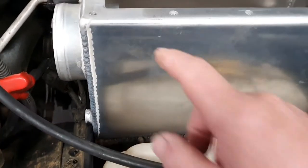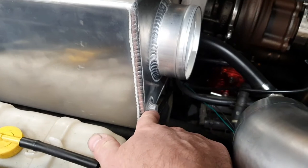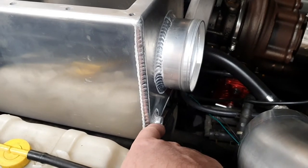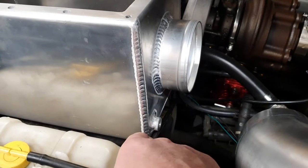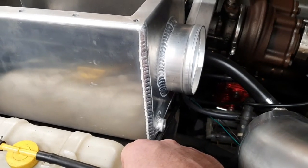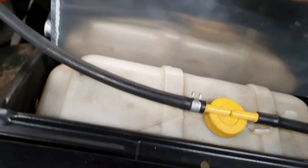There's a minor technical hitch with the air box fitting into the battery bracket area. Several ways to fix that: put a hole saw over the top of that, bore it out, push it flush, weld it back up — done, do that on all four. Or drill holes through the middle, grind that off flush, put a riv-nut on there. Alternatively, drill a hole straight through it, grind off flush, nut and bolt — done. Even just grind them off flush, put a hole through the bottom and put a riv-nut in the battery tray. Lots of ways to get around that small problem.